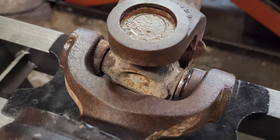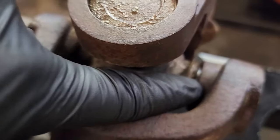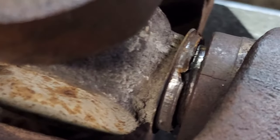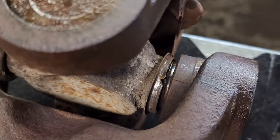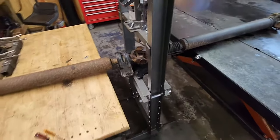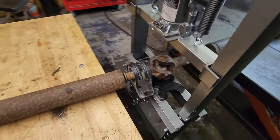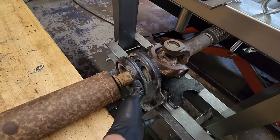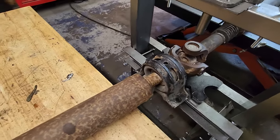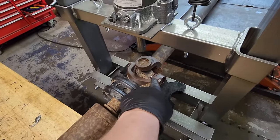The universal joint had a pretty good amount of play in it, and as you can tell that is not good. It even looks like right here the cap is cracked. So definitely have a problem and almost 100% sure that's going to be my vibration problem. While we're in here, I'm debating on replacing this bearing assembly, although it does feel like it's still very tight and doesn't feel like it's bad. So I might leave this alone, but that's going to be our problem.